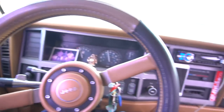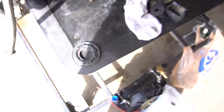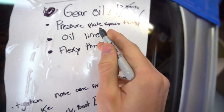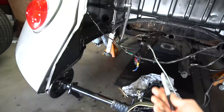I got the pressure plate piece for free — shout out to him. We got everything except motor oil. Look at the difference: the old one is all worn down versus how thick the new one is. On the oil lines, I talked to everyone in the aircooled VW scene including the transmission builder and the shop guys. They all said there's no reason I can't run these lines with hose clamps since oil pressure on a Bug is only about 15 to 20 PSI — steel braided lines are just unnecessary and expensive. So I'm going back to my old fittings, which will save a ton of money.